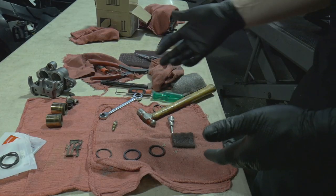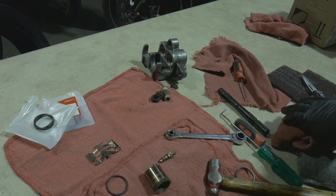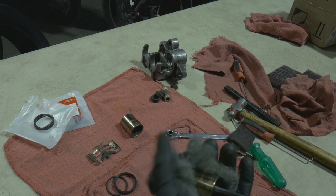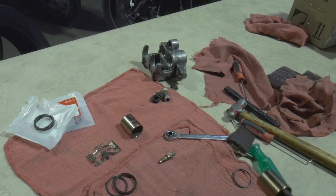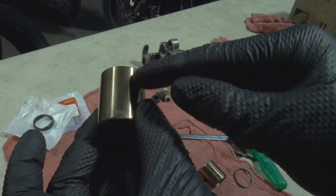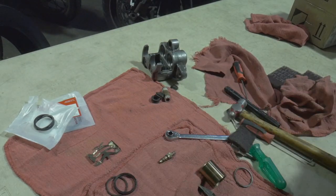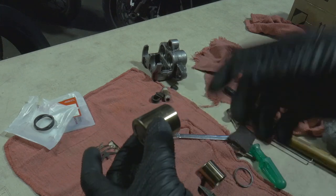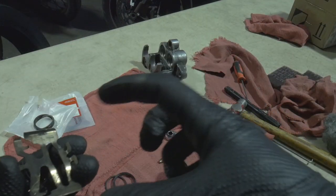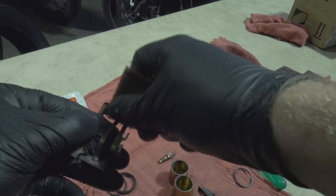You need to go after these pistons — super easy with this reverse plier tool because I can grab it and not worry about it. Get all the junk off first and then steel wool comes into play. Take the steel wool, grab the piston, do that to both of them. Every time you do a brake job, if you're not taking the pistons all the way out, it'll collect dirt from the lip. Pull the piston out far enough to see a nice clean portion and polish it up with steel wool, a brass brush, whatever you want to use. Make sure you clean with compressed air and contact cleaner before you push the pistons back into the caliper. You can clean up the spring pad as well because the floating brake pad will slide on it.